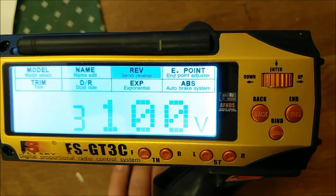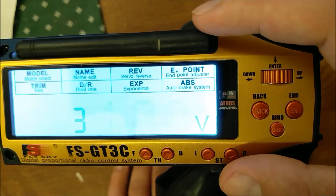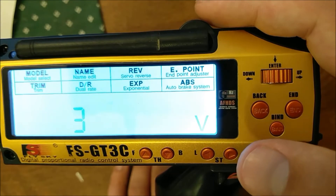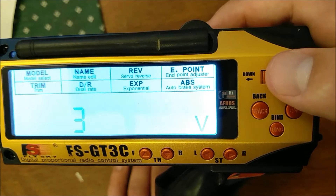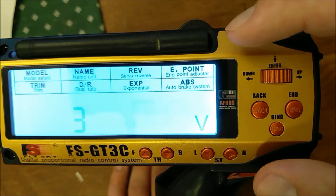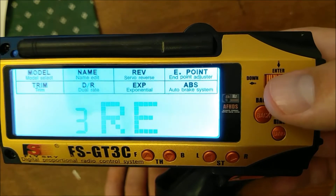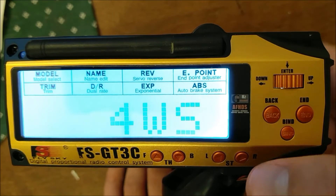So you can have 3 different control areas. Negative 100 will be rear wheel steer only, 0 will be 4WheelSteer, and plus 100 will be just front steering. If you wanted full front steering and only half rear steering, you could set it to 50 — a positive 50 would be full front steer and half rear steer. For just normal applications I set it to 100 and press it in. Just keep clicking through the remaining options and that's it — your 4WheelSteer should be set up.